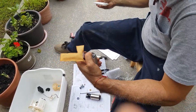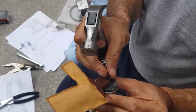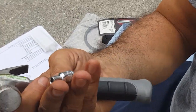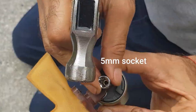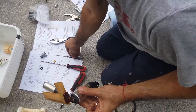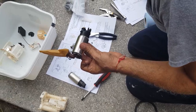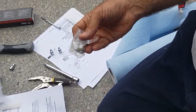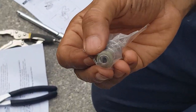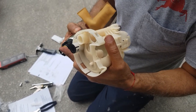I decided to reuse the old retaining clip — the new one is a little bit too big and might interfere with the OEM filter strainer. Used a 5mm punch, set it right in there, and hammered it in nice little by little until it's fully seated and locked in. I also bought a new regulator — even though the original looks like it's working great, I'm not going to take any chances. Took this apart and I'm going to put in a new regulator as well, plus a thin coating of grease for easier removal next time.